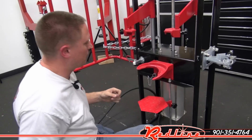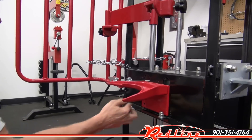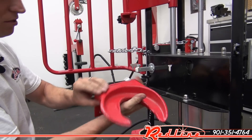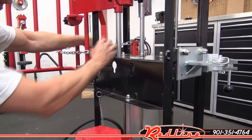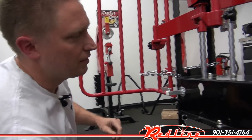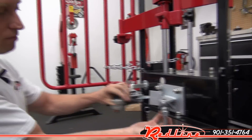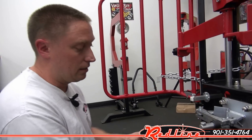One of the things I want to show you about this spring compressor is you've got three different adapters for the base here. You have a little pin that you pull out right here. You can pick your adapter up — it's a great big steel construction, powder-coated, cast adapter. That's your large diameter adapter. Over here on the back side, we've got another adapter — that's your small diameter spring adapter. And you've got one more over here: the universal unit. To mount these to your spring compressor, drop it in right there, clank your spring in place, put your pin in place, and that's about it.